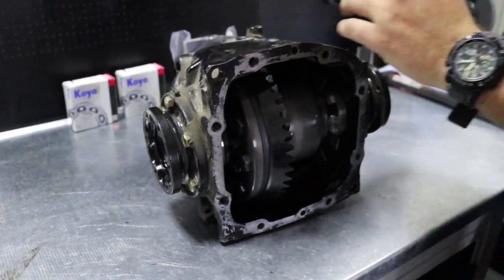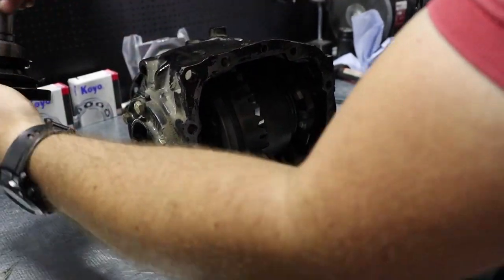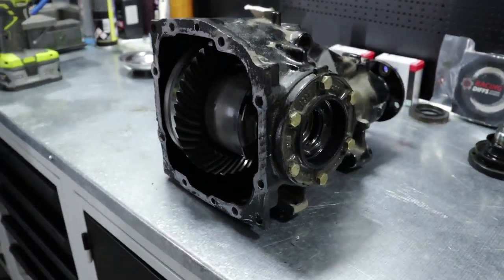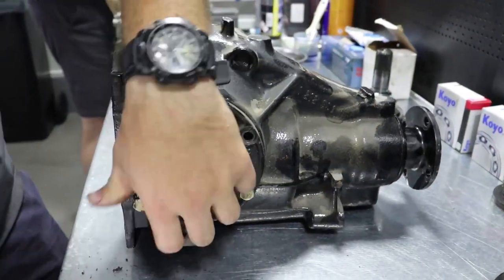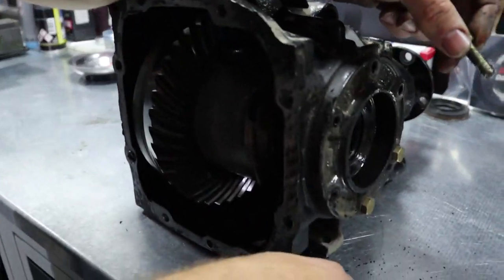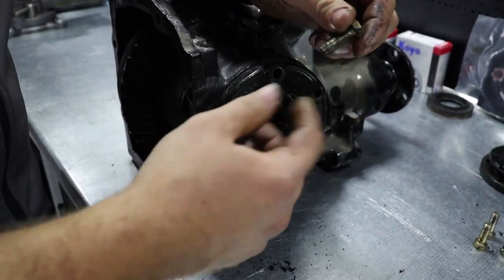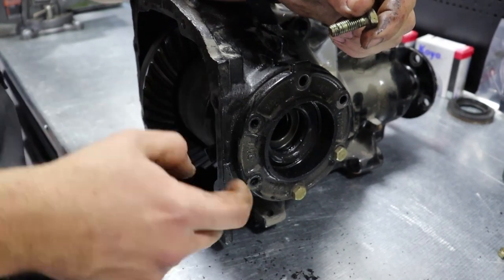Removing side flanges first. Side caps. Just to find the tool. Small piece of advice right now at this point, as you noticed already, this is a sealant paste which goes out from this and this hole of the cap, so when you tighten these screws right here, use sealant paste because the hole goes through the housing and oil can leak from these bolts outside. You don't want that.